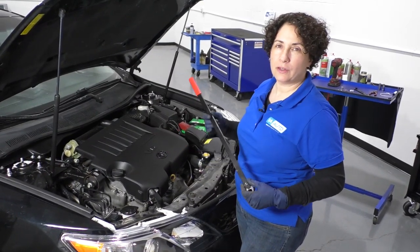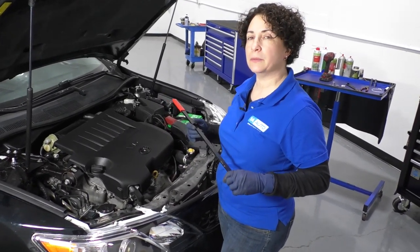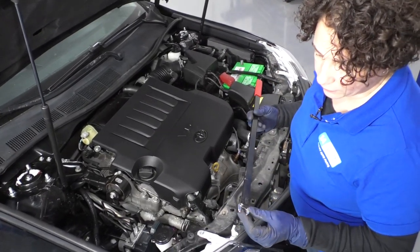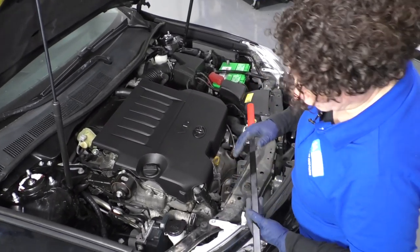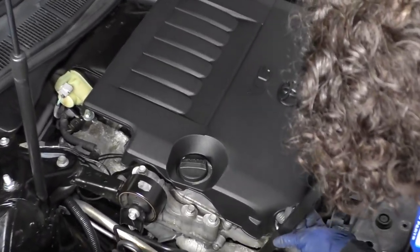To remove the serpentine belt, you need a special tool or a really long wrench. On this case, it's a 14 millimeter head on a tensioner bolt, so I've got the open end on our extended handle. We sell this tool on 1A Auto's site — it comes with several sockets and an extension for angles. I can use it just with the crow's foot.